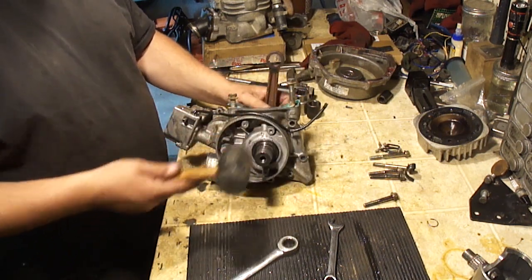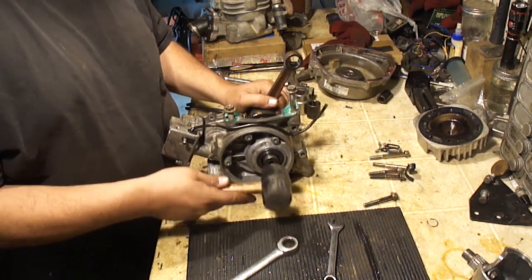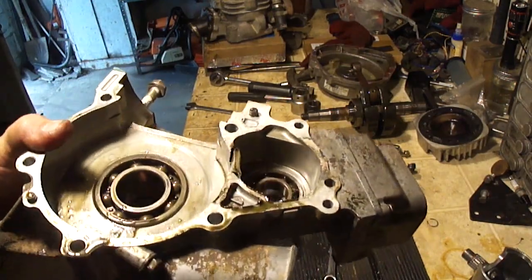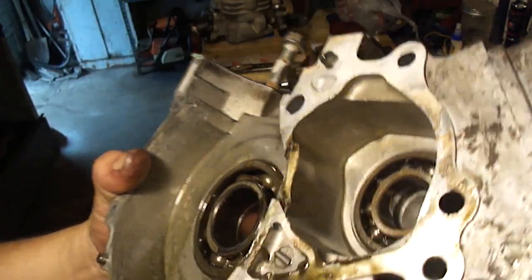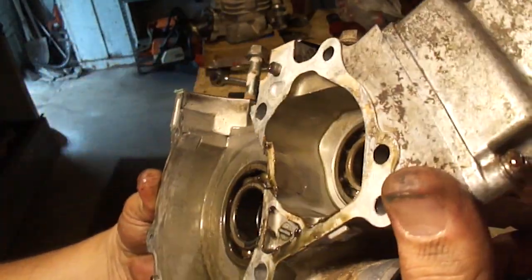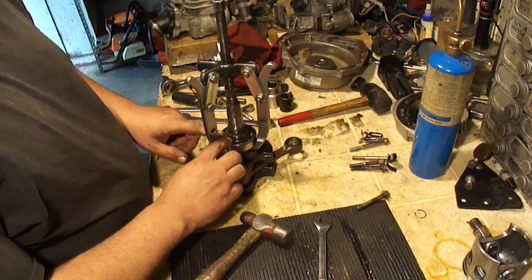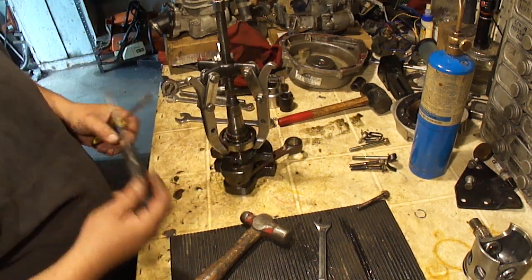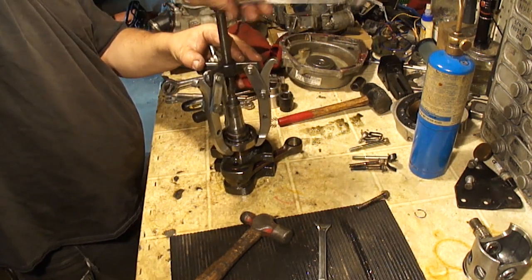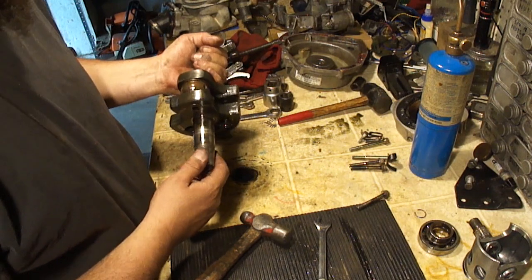Since this case split so easy I'm just going to attempt to drive this crankshaft out of this case half using a rubber mallet. Look at that — this is where the balancer shaft goes, something really destroyed this thing. This bearing wasn't on there very tight. I heated it up right around the inside race just a little bit, took a couple screwdrivers, tapped them in, and was able to get this puller on here. There's one of those spacers right here with an o-ring inside. Unfortunately this crankshaft needs rebuilt.